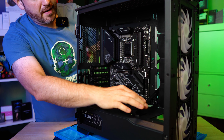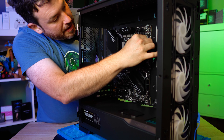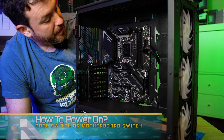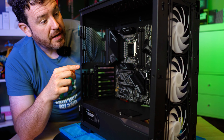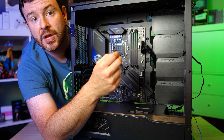The 24-pin looks exactly like this — it's called the 24-pin because there are 24 pins on the motherboard side. The part that goes into the PSU is split into two cables. We're going to look for those ports on the PSU and this port on the motherboard. This EVGA cable nicely says 'MB' on one side and 'PSU' on the other, telling you exactly where each end goes. The cable port on this EVGA power supply is on the bottom. Note: these connectors only go one way, so you don't have to worry about getting it wrong. You will note some flex in the motherboard as you're doing this — that does tend to happen when installing such a large connector as the 24-pin.